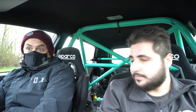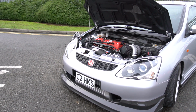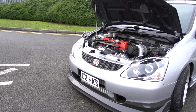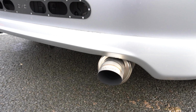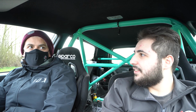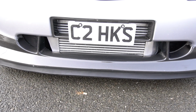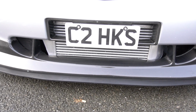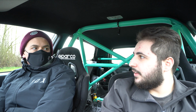Okay, so K-Series turbocharged. It's running an RW Developments Sidewinder manifold, downpipe, and a 3-inch exhaust leading into a K-Tuned and RW Developments mix. One back box, so basically just the rear silencer. Pretty loud. A Pulsar Turbo Systems turbo, so it's kind of a Chinese turbo, but not. It's not a bash spec. RW Developments intercooler and pipework, with a Tedua radiator that he's cut down to allow a shorter intercooler run. And that's it, standard internals.